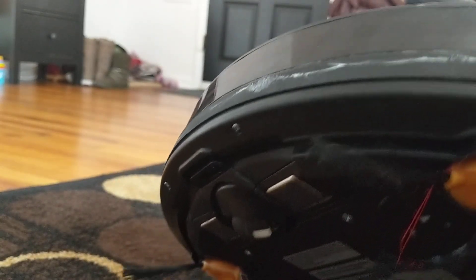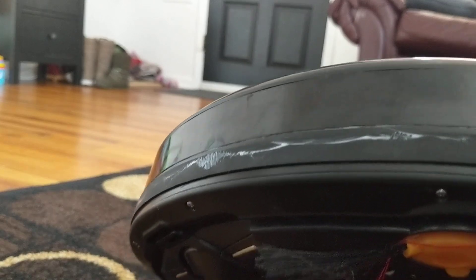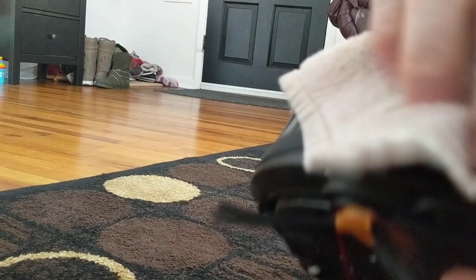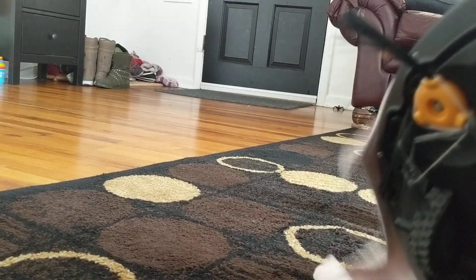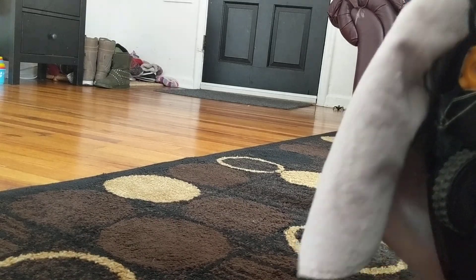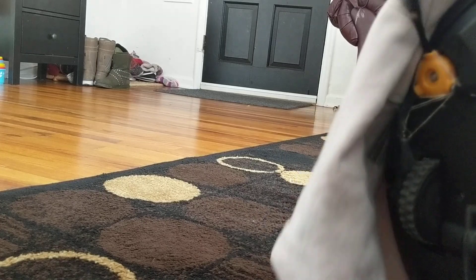After buffing for about five more minutes, the last step according to the Meguiar's instructions — and every other plastic polish I've used says the same thing — is to take a dry clean piece of terrycloth and wipe off any excess residue. You can see there's no white leftover. I make sure to do this thoroughly, because if the infrared can't see through scratches, I'm guessing it can't see through white plastic polish residue either. By this point you can feel how much smoother the plastic is.